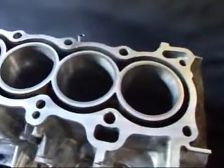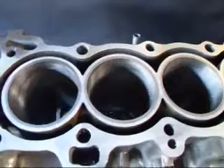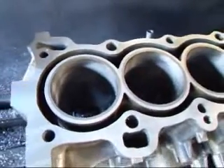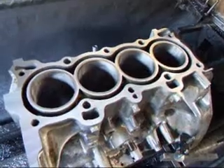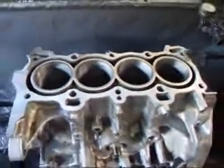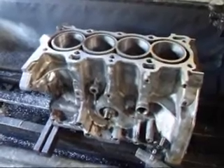As you can see, we have a real nice flat surface here — no more black marks, no more hollows for the gasket to fail. This is just the type of surface that we need for a multi-layer steel gasket. If you have questions about Honda engine machining, give John a call at Costa Mesa R&D. We'll see you soon.